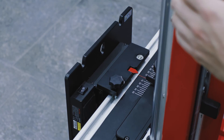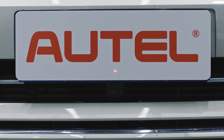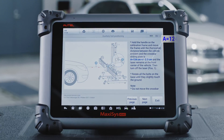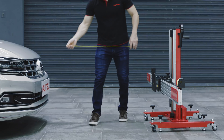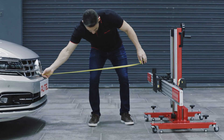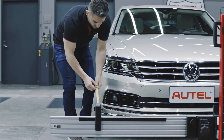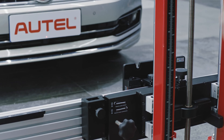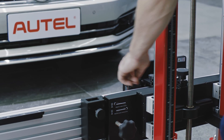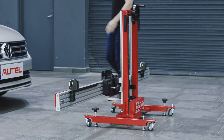Turn on the laser and aim it at the front center of the vehicle. Adjust the height of the crossbar so that it is level with the center of the front wheel. Move the frame slowly to reach the specific distance between the vehicle emblem and the crossbar sliding plate, keeping the laser spot in the center of the front of the car. Ensure both sides of the crossbar are at the same distance from the center of the front wheels. When the frame is in position, power off the laser. Rotate the bolts on the base until they lightly touch the ground.